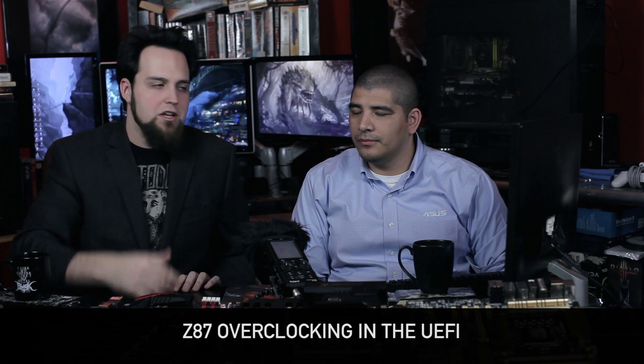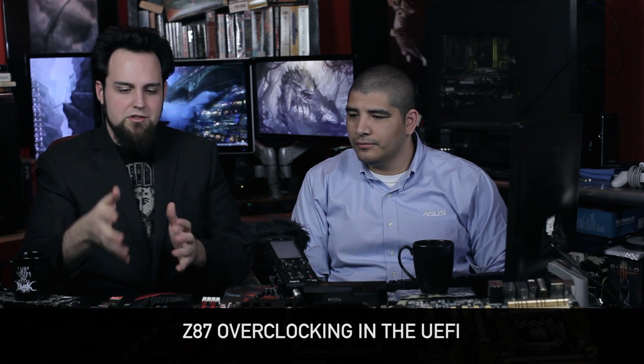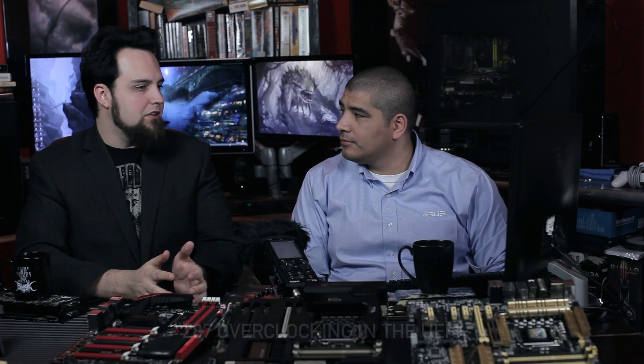The CPU does get warmer with the IVR, and that's going to create some limitations as far as overclocking goes, but it can still be more stable. We can get into that in our overclocking video — there's a link you can click to check that out. Right now what I want to talk about is what's different about this compared to Z77. The K series part is going to have some increased levels of adjustment because of the IVR changes that Intel have put in.